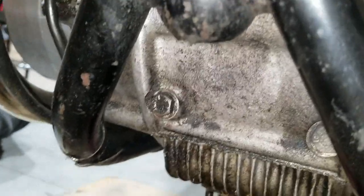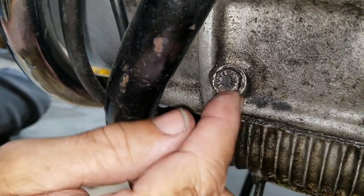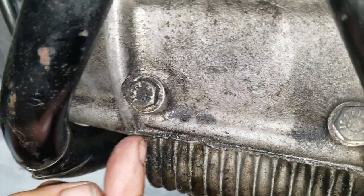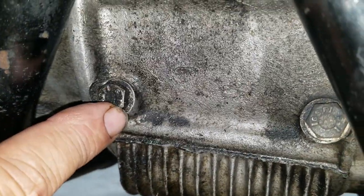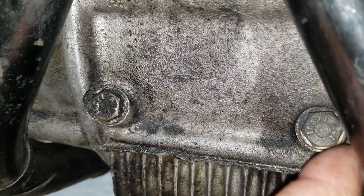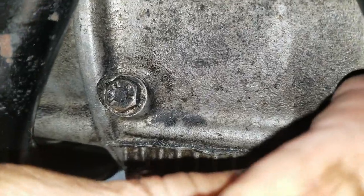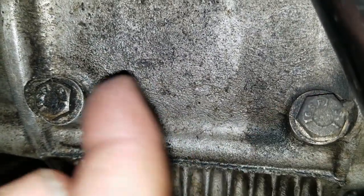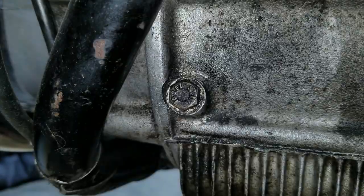So what are these bolts for? They're the main bearing oil galley, so they're under full pressure from the pump. So either one would work, but this one is closer to the frame, and it's hard to get the bolt in there because this one's more open. Oh, I see. Yep. So we're going to use it.